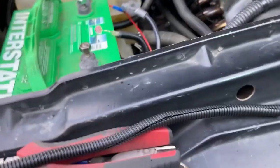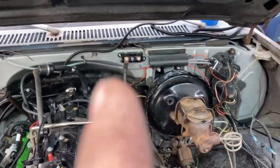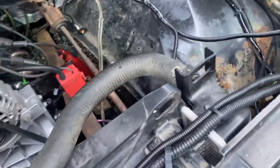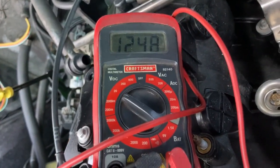I'm going to give you guys a little update on where I'm at. I'm going to hook up the positive cable and the negative. So theoretically I should have volts at the mega fuse. Let's turn on the voltmeter — touching that gives us almost 12 and a half volts. And you come off here to the hot side of the alternator — same thing. So in theory the alternator will charge the battery through the positive cable.